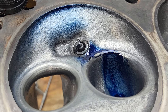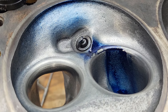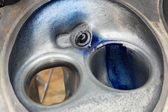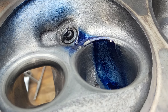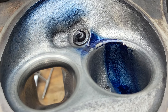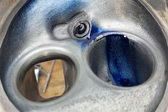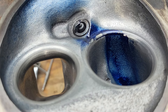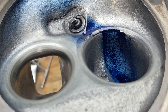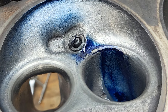Back on the 318 Mission Impossible. Tried to reclaim a few of the CFM I lost putting the multi-angle valve jobs on. All I did is I hit both of these seats with a 60 under the valve seat. I could have done something fancy, but that's basically what it was beforehand — just trying to get back a couple of those CFM we lost.